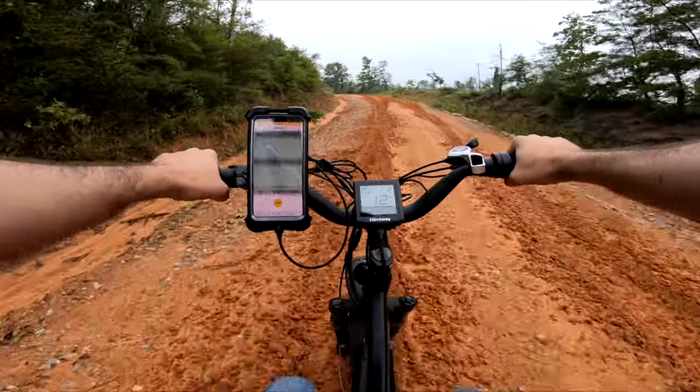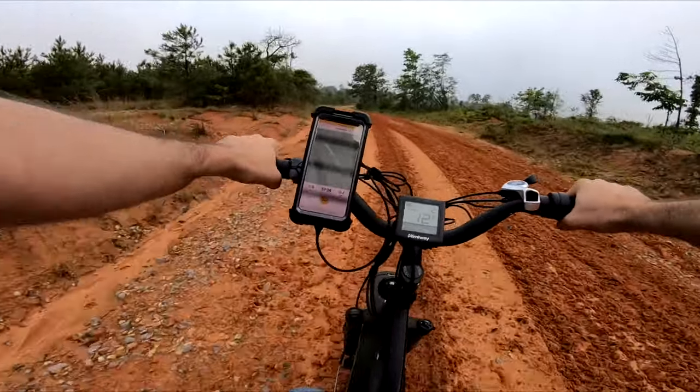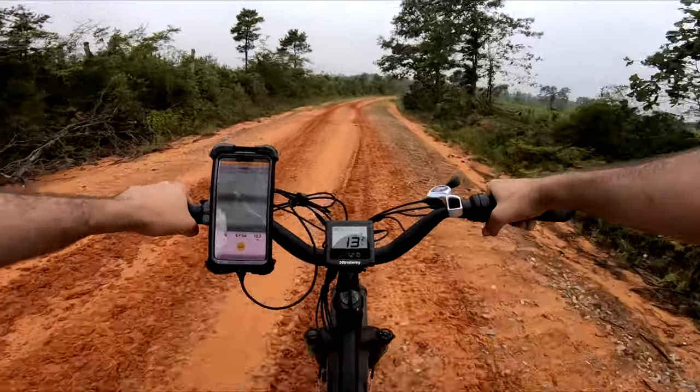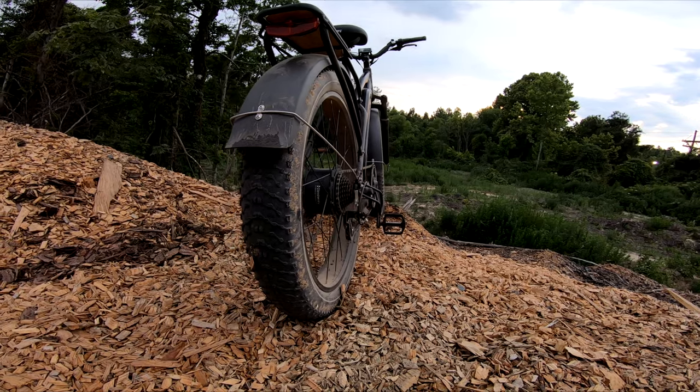Another customizability option in the display is that you can actually set the exact voltage when you lose each one of the bars on the readout. Ideally, I would still like to see a voltage readout for ease of long distance riding, but being able to set your own custom battery bar indicators is a definite bonus.